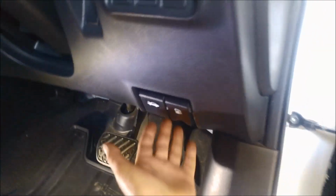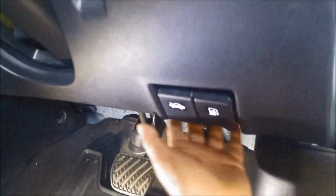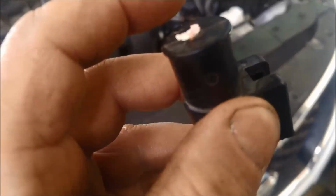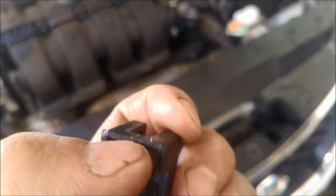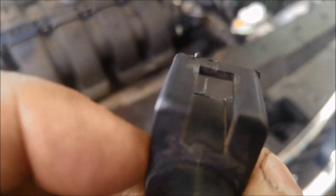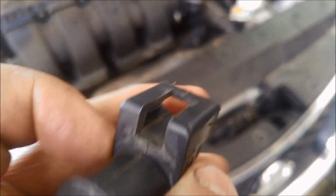I'm just going to do a quick scan on it. The OBD plug's under here in Australia on the right hand side. There it is there. The way to get these plugs out on the transmission is to just poke a screwdriver there. It actually holds on this bit here, and the idea is to just flex it just so you can pull it out.